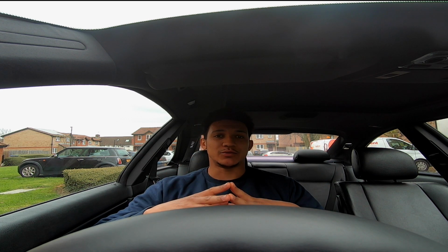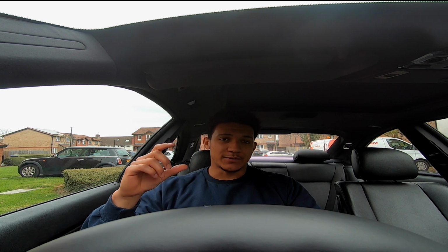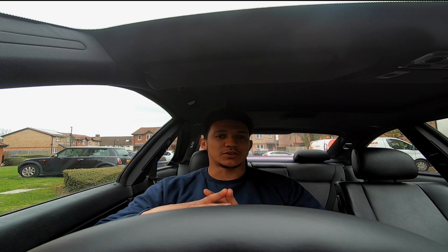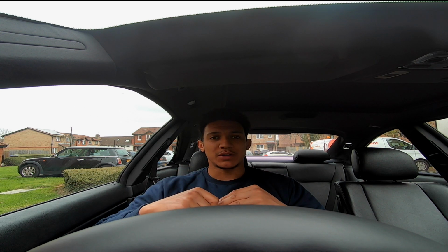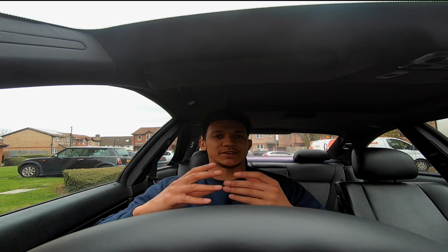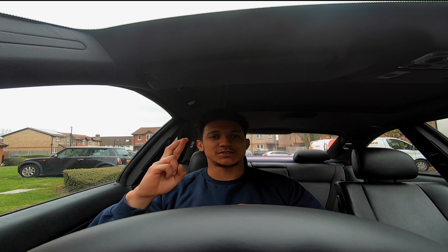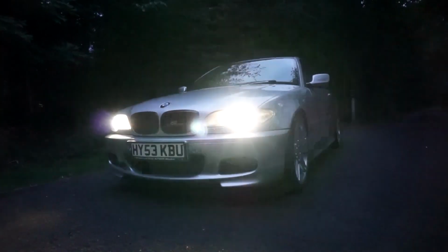Today I'm hoping to make some gaskets out of gasket paper, get the carb back on and see if the car runs for longer, because if you can remember, it kept on cutting out once it sort of warmed up. I don't think it was getting the fuel that it needed. Some things were blocked up inside the carburettor, but now it's fixed, so fingers crossed it all works perfectly.